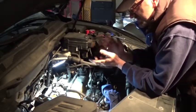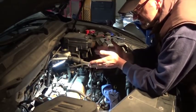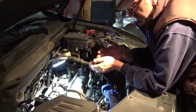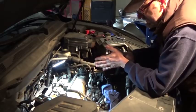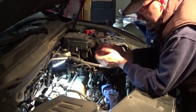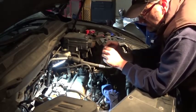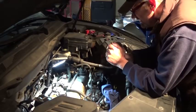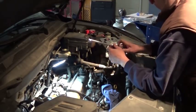I mean, it's a little sluggish. Actually, this is what happens. I didn't even drive this car because it needed the rear brakes and the tune-up, and the customer never really complained about any drivability issues, but it is kind of a little slow and sluggish, and again, we see a lot of turbulence in a cylinder on our spark line. And so I'm gonna try to show you guys.